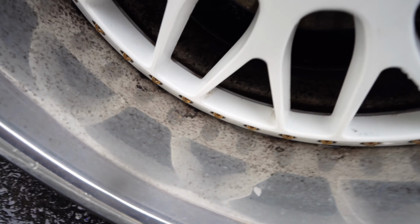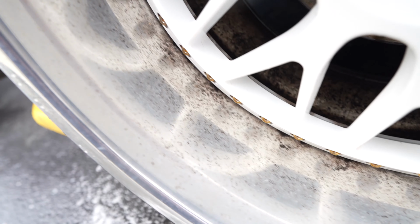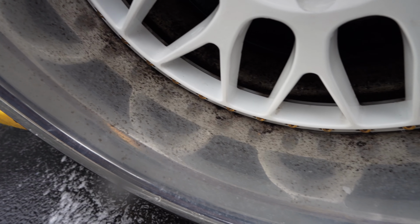Okay, so you guys just saw that clip of the cleaning. The only thing that's not coming out is the pitting, as you can see. The fronts are a lot worse than the back. Back's cleaned up really well. They're hazy, but that's fine. I'll probably see if a compound can take that out. I do have a 2500 or a 5000 grit, and then I will polish it out and then hit it with actual aluminum and a mag polisher that I picked up from the store. But the white faces came out great. That wasn't the issue. It's more so the aluminum lip we're trying to polish.